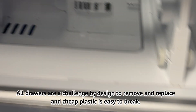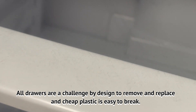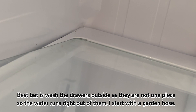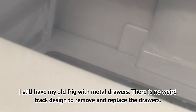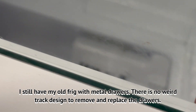People have also had issues with this glass shelf. You want to slide it forward — see how I have a lip over this support system. Get it out of the corner back there. Don't try to have it all the way back and then lift it up; you've got to get it out of the corners or you could break them. Pull it forward, support it, and you can keep it in the track to clean the top and the bottom. When you slide it back in, support it from the bottom — you really need two hands to do it properly.